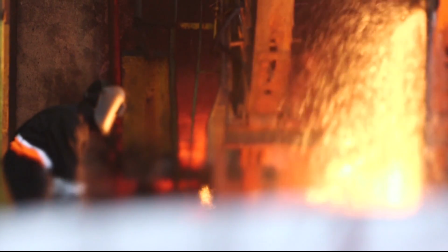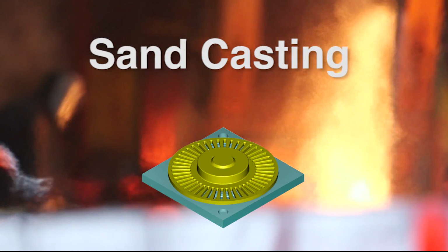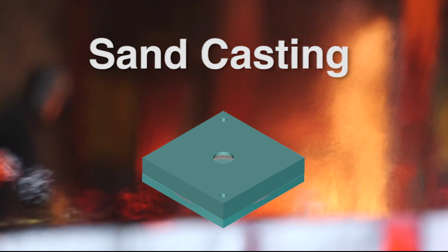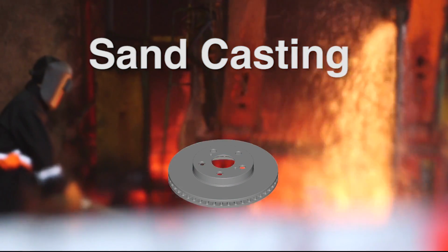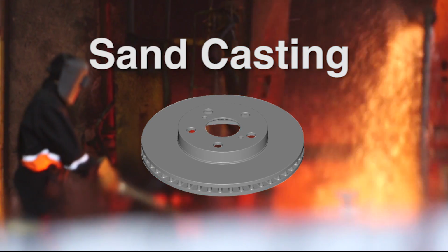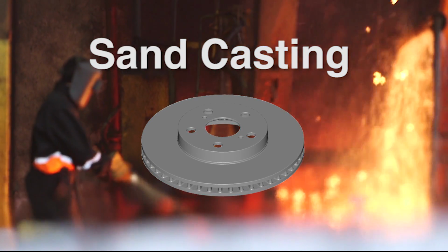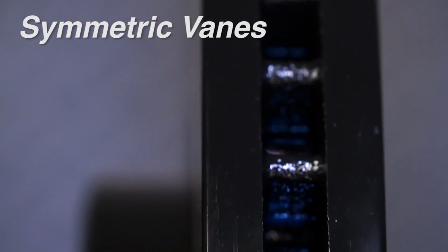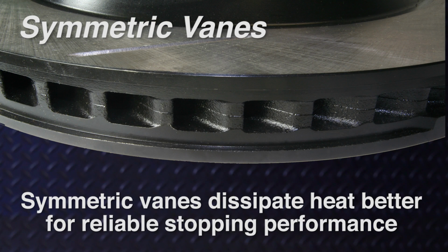You might not realize it, but brake rotors are formed using sand castings, where molten iron is poured into the cavity of a sand mold. Ventilated brakes require a separate inner casting for the vanes, which is suspended between the two rotor halves. Centric premium rotors feature OE-style symmetric cooling vanes, which dissipate heat more effectively and provide more reliable stopping performance.